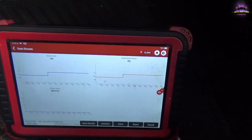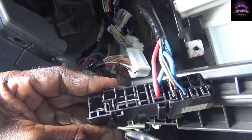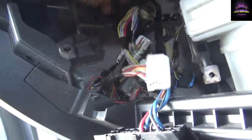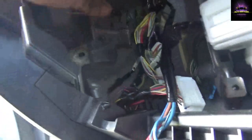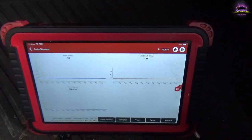The C12 connector should be somewhere back here behind the fuse box area. I've pulled out the jacks from the back and I'm doing some inspection of the connectors. I'm just going to clean them up — there's some contact corrosion on them. Corrosion and moisture tend to get into some crazy spots. After cleaning and putting everything back together, the brake switch is now off.